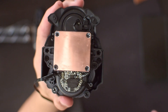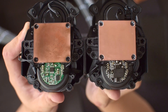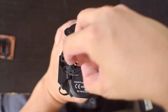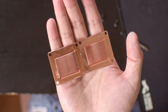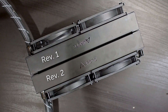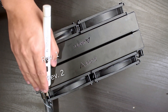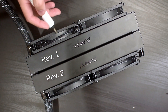Removing the screws for the plastic housing of the PCB, we can see that has changed in a rather big way — not only is the colour of the PCB different from green to black, but the board layout is also completely different, which is super interesting, and the little foam to dampen extra noise is now glued to the PCB instead of the plastic housing. I was also curious to know if anything on the inside of the block itself had changed, so I removed the copper cold plate from both coolers to compare them, and it looks like nothing had changed there. Moving on to the tubes, nothing has changed there either, and on to the radiators — while the fan and radiator itself haven't changed, the fan cables that run out of the tubes are now substantially longer than before, now terminating at the middle and at the end of both fans instead of at the top and middle before.